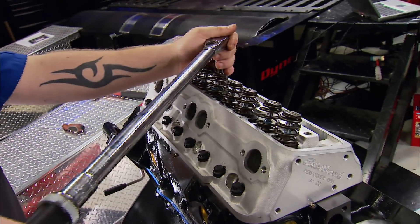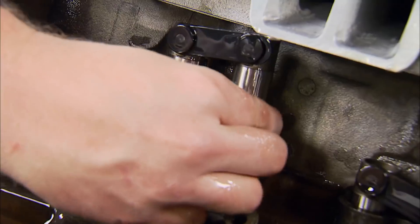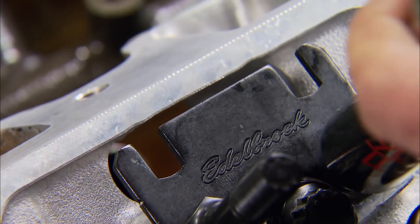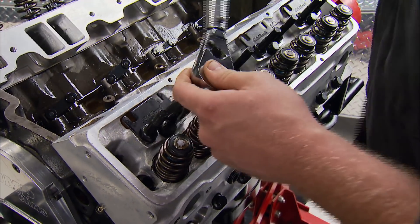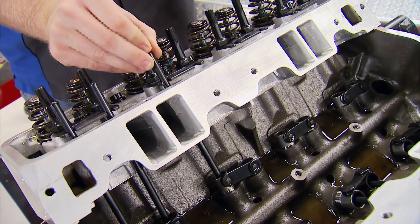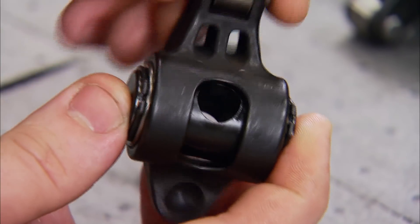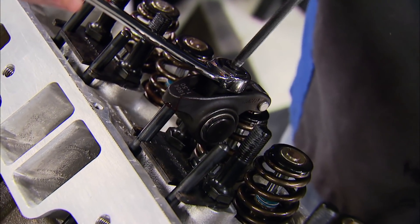Our new lifters from Comp are a retrofit lifter held together with a vertical tie bar — racers have been using these for years. We're also upgrading to 7/16 studs from ARP. Here's something I learned from an old-timer: the guide plate moves when you torque it, which can put you back in the trailer fast. You fix it with a screwdriver and slight pressure to hold the guide plate still while torquing. I pre-measured for push rods at the machine shop and ordered Comp's high-tech version — stout 5/16 push rods. We also upgraded to new Ultra Pro Magnum rocker arms with a hardened roller tip, oversized roller trunnions, and precision-sorted needle bearings. They're rebuildable, and Comp backs them with a lifetime warranty.